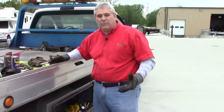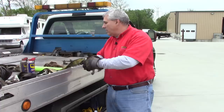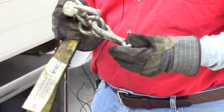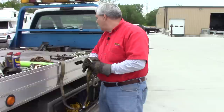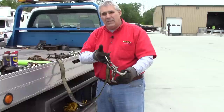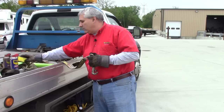When you get into heavier applications — pickup trucks and SUVs — I don't feel the over-the-wheel strap is always safe enough. With J chains I'll use something called a cluster strap, which has the same attachments as a V-bridle: an R hook, T hook, and mini J. I can also use this to tie down and secure the vehicle. The J chains go in front and the cluster strap secures the vehicle at the back of the rollback. It's also a handy recovery device — the wire rope can hook into it to help extract something from a ditch.